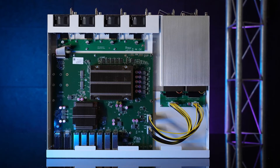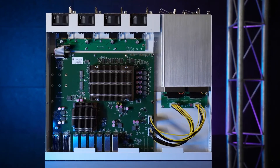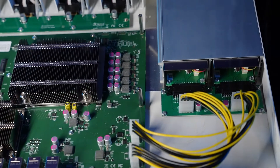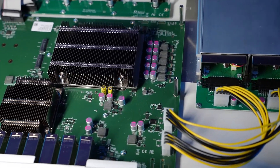This is the reason why this model is called 2216 and not 2116 — instead of 4 10G lines to the CPU, this switch has 4 25G lines to the CPU. Speaking of CPU, most Layer 3 hardware offloading features would not be possible without a powerful CPU.